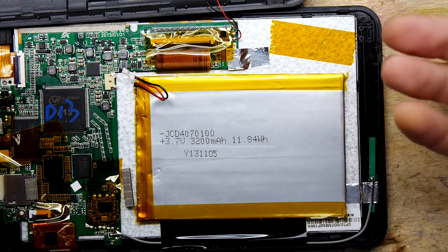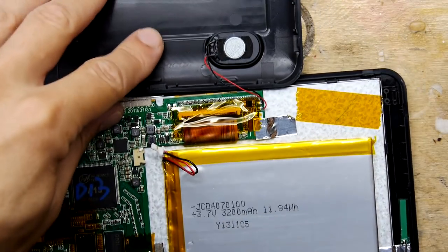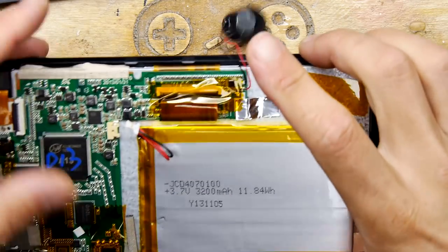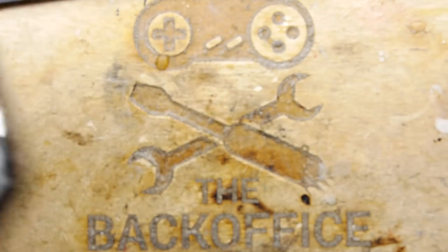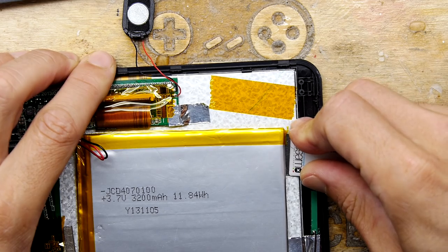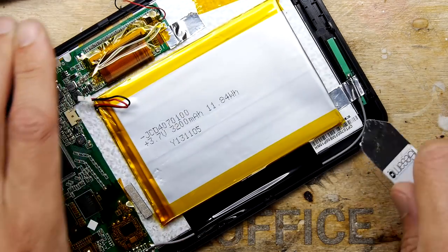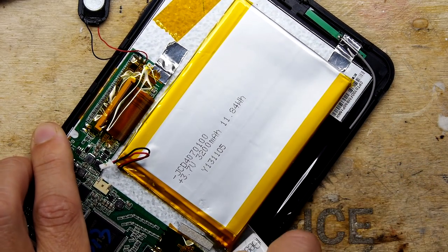If we were going to fix a tablet you'd have to go through a similar process, and the problem is normally they're glued down. I'm going to pop this speaker so we don't damage anything, and I'll turn my soldering iron on in the corner too. Now the problem with the batteries is they're normally glued down, so you don't want to burst them — you could start a fire. I'm just using a spudger, dragging it across the back of the screen so it's not putting force directly on the battery.